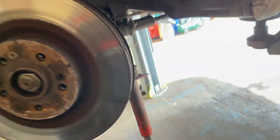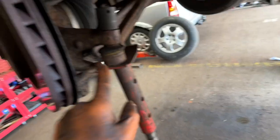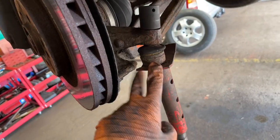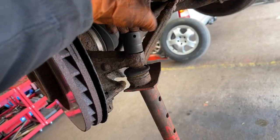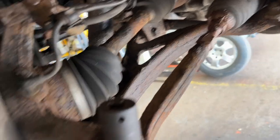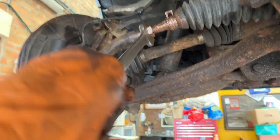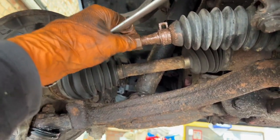This is why I like towing with this car — it tows my caravan like there's nothing on the back. Onto the task: track rod end. I've got a transmission jack on it because you need to put load on the ball joint — naturally when it's worn it'll spin freely and you won't get the nut off. I've got the new one ready. The tie rod end is a 22mm. Anti-clockwise — these are slack because I purposely left it slack. There we go, that's freed off.